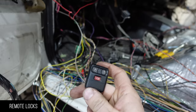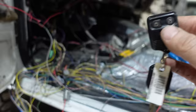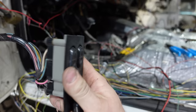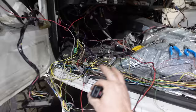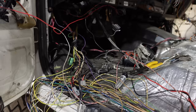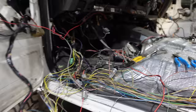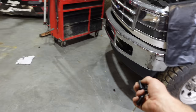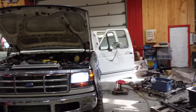I teed the two systems together for the power locks. A fuse running the power locks for the regular cab only did two doors on a 20-amp fuse. I'm worried because things are just tight — I gotta lube everything up with WD-40 — but I had to put a heavier fuse in because it kept popping. We do have working locks. I'll order this motor, wire it in properly, clean everything up, put some Deutsch connectors in rather than these crappy plugs, so we can still plug and unplug everything, and then run our power windows. The nice thing is when you lock and unlock, the lights also come on.